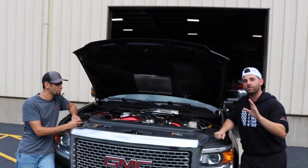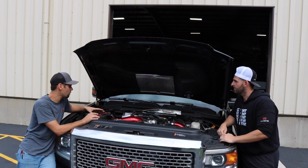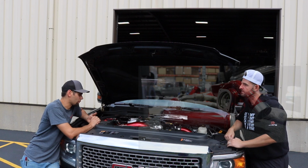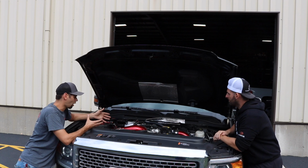Yeah, so Matt's truck already had a couple of our pipes on it. He had our intake, our coolant pipe, and our driver's side intercooler pipe already installed when he showed up. And the main reason for the visit was to install one of our new S300 drop-in turbo kit upgrades. So this kit is a really slick setup. What we've done is we designed an adapter that lets you incorporate the OEM turbo pedestal and install an S300 fixed vane turbo. So we eliminated the factory VGT.